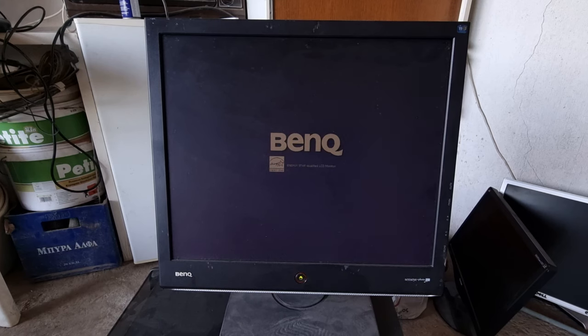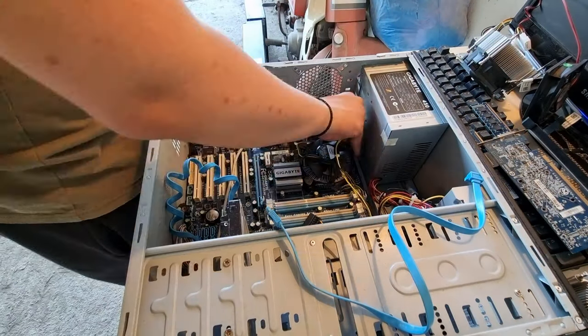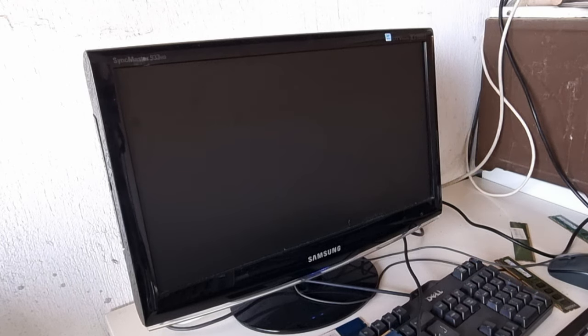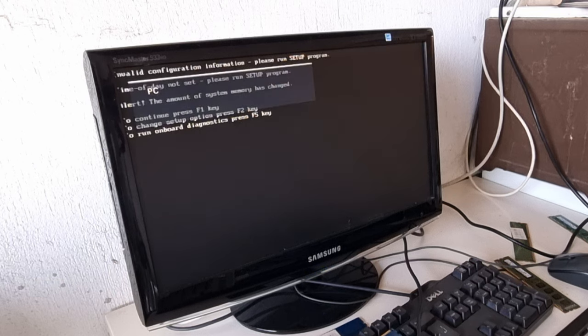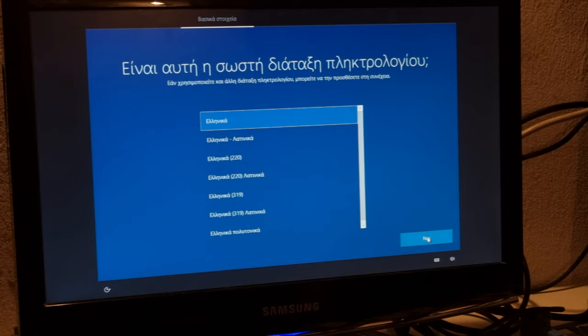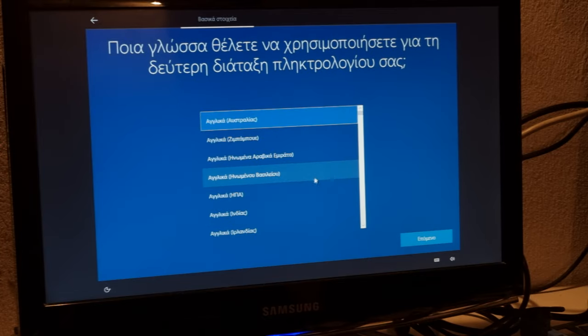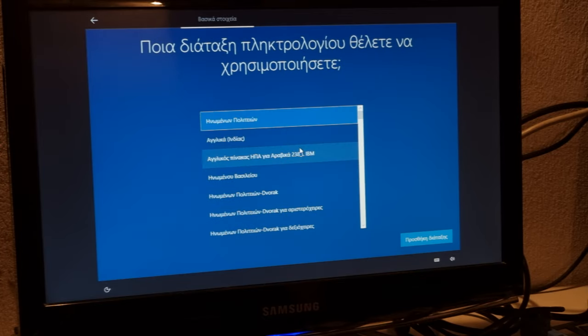And just like that, this is it. 3 out of 6 computers were fixed, and 3 out of 5 monitors work perfectly fine. Some of the issues on the computers were minor and easy to fix, and some were major, rendering the computers useless. All that was needed was a RAM reinstall or new RAM for the Dells, which got them back up and running like they were just pulled out of the box, considering they looked spotless cosmetically. This goes to show that some people don't put enough time into diagnosing the problem or calling someone who knows about these things, and instead retire the PC completely — even if it's still worth being used by someone else.